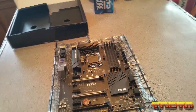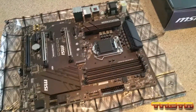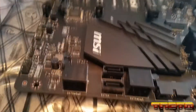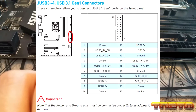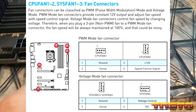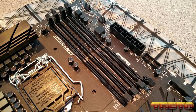Now I'm going to give you some close-ups of the board. Over here we have our six SATA 6 gigabit headers - two on one side, two on the other side, and another one there, six total. Then we have our USB header, our 24-pin power for the motherboard. We have a SysFan header which is voltage regulated, and a SysFan 2 PWM header which I'm going to use for the front two intakes. We have four RAM slots, DDR4.